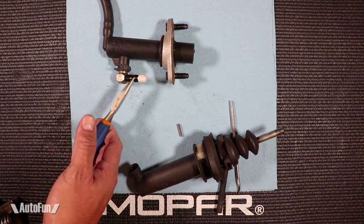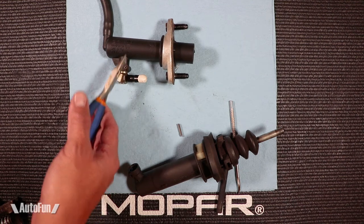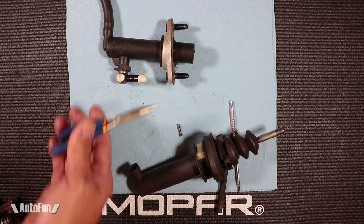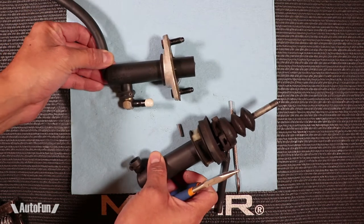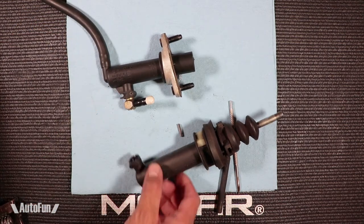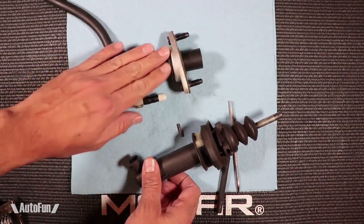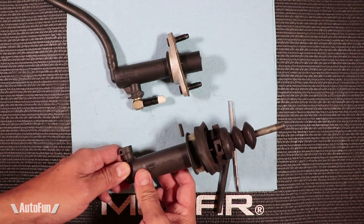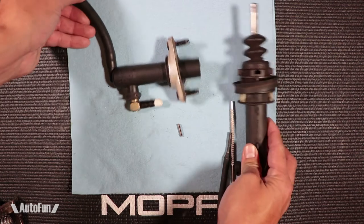Replacing the master cylinder is very tricky because it's kind of far inside the car, so most of the time when you're replacing the master cylinder, you'll probably be replacing both sides. The factory manual describes them to be replaced as a set if you have to replace the master cylinder. In my case, I'm going to be bleeding a brand new master cylinder that's fully dry — there's no fluid in there — and a slave cylinder that's also fully dry. So I'm going to bring those parts in and we'll take a look.